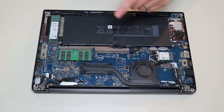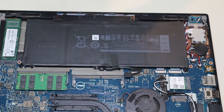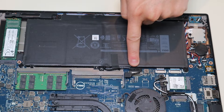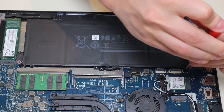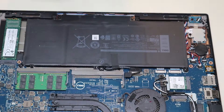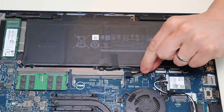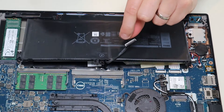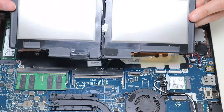And this is what you're looking at for the inside of your computer. Before I touch anything inside, the first thing I always do is remove or at least unplug the battery — it makes it safer to proceed. This battery has two screws in the corner and is plugged into the motherboard. The battery plug has a simple pull tab that you would just grab and pull up to unplug the battery, and then the battery releases.